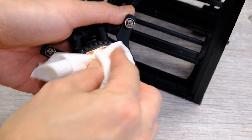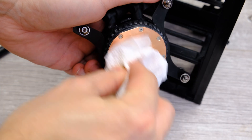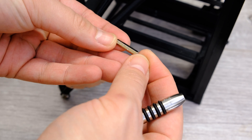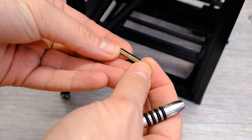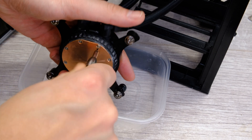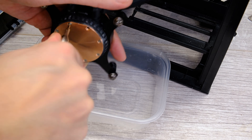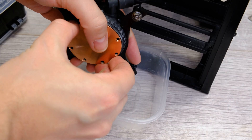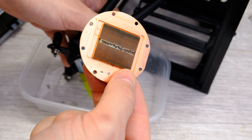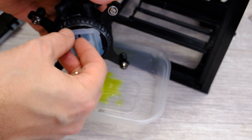Having fixed it by clearing out this crap and refilling with aftermarket coolant, here is how you do it. First, clear off all the thermal paste from the underside of the cooler, otherwise it's going to get everywhere — all over your fingers, your clothes, and everything you're working with. You will need a T6 Torx screwdriver to fit the screws on the bottom of the contact plate. There are about eight screws to remove, and make sure you use a drain container, because as soon as you remove the last couple of screws there will be coolant coming out. As you can see, even after a flush there's still more crap left in the contact plate.